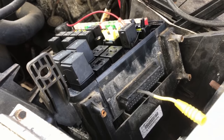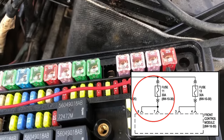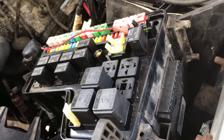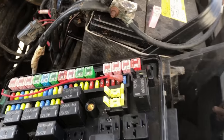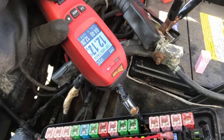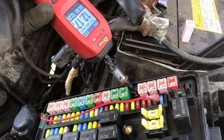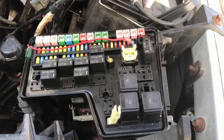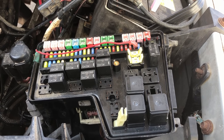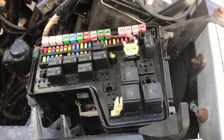Let's take a look at the diagram and see what fuse feeds pins six and seven. According to the diagram, fuse 11 — which is this missing one here, I just pulled it out for testing — it's a 30 amp fuse that feeds pins six and seven on the front control module. I want to make sure we have good feed to the fuse. We have 12.1 to 12.2 volts on the feed side, and it has the ability to light the bulb. So basically that tells us the fault is inside the integrated power module.